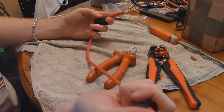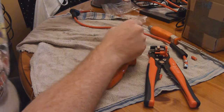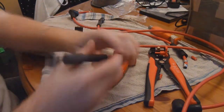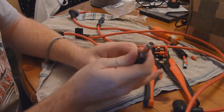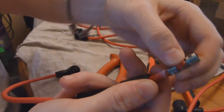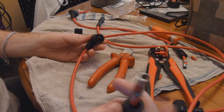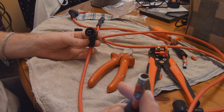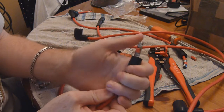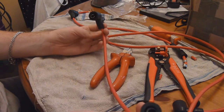Before I do that I'm going to put some epoxy resin on the ends just to make doubly sure they aren't going to move. What you'll be left with is a lovely set of HT leads - these ones have already been done. If I take the collar off this one, you can see I've put some glue around the end here to hold the lead even more securely within the connector. I've gone over these with a multimeter to check the continuity and they've all got very good connections. The resistance is actually very low - reading around about 10 ohms, which is quite a lot lower than a lot of standard HT leads.